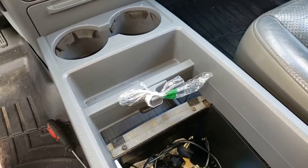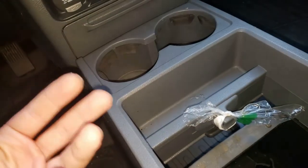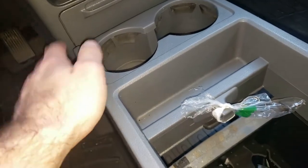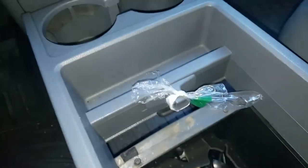Now I'll search for those screws underneath. One thing to note: somewhere online I was reading that the screws underneath here — the five screws — are Phillips heads. They're actually not. They are stars, or Torx heads, whatever you call them. Little small stars. So that's one screw, two screws, one right up there, one right in the middle, and one right over here.